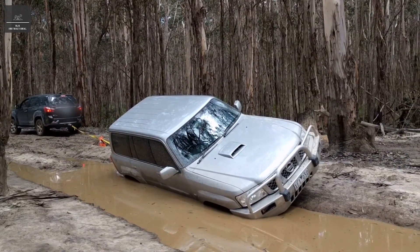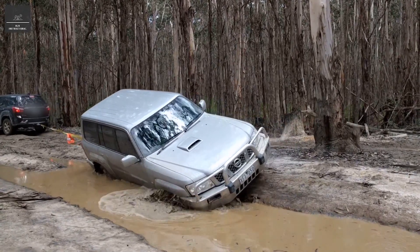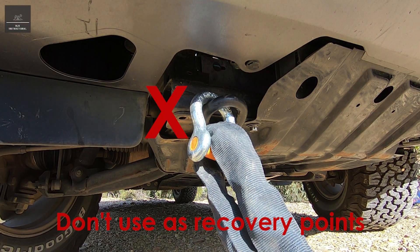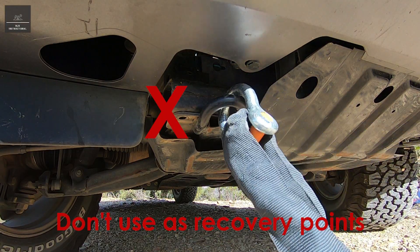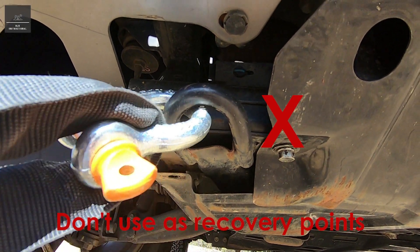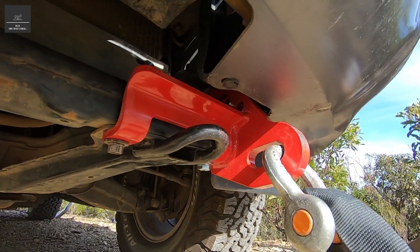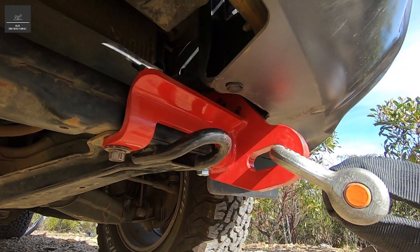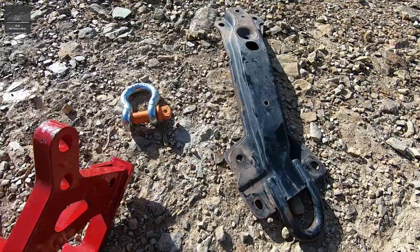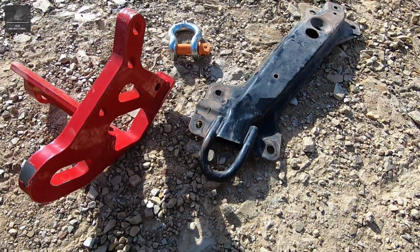This is especially true of a fully loaded vehicle completely stuck in sand or mud and being recovered by a snatch strap. The factory tow points, no matter if rated, are typically not able to withstand recovery situations and in my opinion should never be used. No matter how small or big the recovery, you should only use suitable recovery points able to withstand the large forces generated. A factory tow point can break off and potentially become a lethal missile, and a fun day on the tracks can become very tragic.